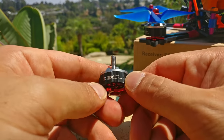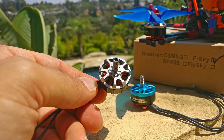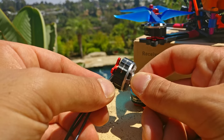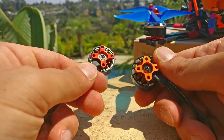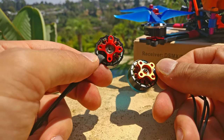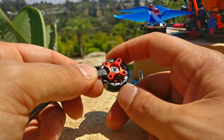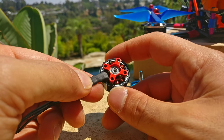What these ridges — the rings around these motors — are doing is something I never even considered until I saw this motor. The ring around these motors is actually ferrous, they are magnetic, they have an iron property to them, and the thickness of them matters. Hobby King had a motor with a carbon fiber bell and it just died super quick because people realized it wasn't very good — and this is the reason why. This metal around the sides actually does something for the magnets. The magnets used in these motors are pretty strong, as strong as they can get with reasonable cost.